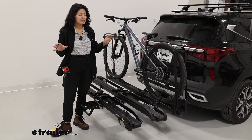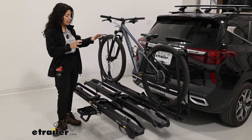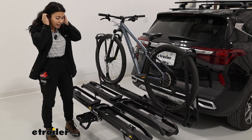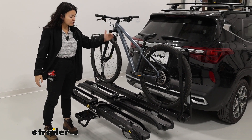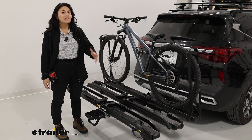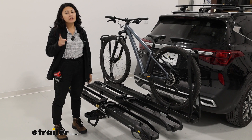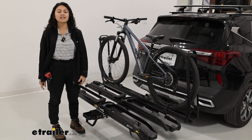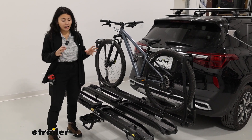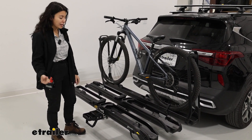Right off the bat, I'd have to say that this isn't the best fit for the Seltos, with the Seltos being a smaller SUV and this bike rack being a super heavy duty bike rack. This does have the capacity to carry around two 80-pound bikes as well as a 35-pound bike at the very end, but your Seltos may or may not be able to carry that much weight, so please double check your tongue weight capacity of your hitch before loading up your bikes. It's still worth taking a look at because I like this bike rack kit with how sturdy it is compared to other dual wheel mount bike racks.